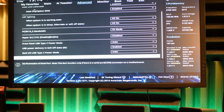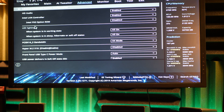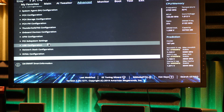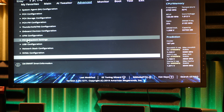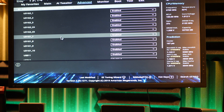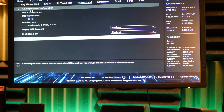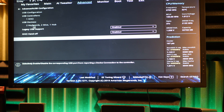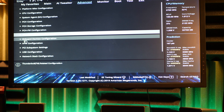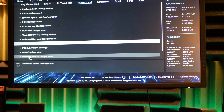A lot of the stuff doesn't matter, but you may notice there's some other stuff I decided to do as well. You can actually tone down the overclock a little bit so it makes all six cores run stable — a lot of that is on the Pro Tools website, or whatever you're trying to configure it for, you can usually find really detailed information. But there was something about the USB bus needing to be constantly on so it doesn't change power settings in the middle of a session. Some of them have like a sleep mode.